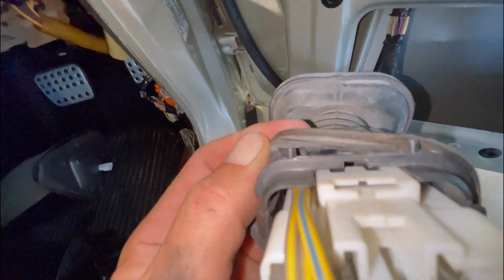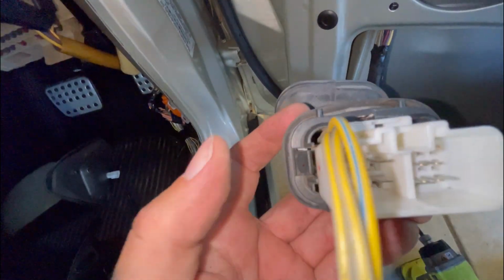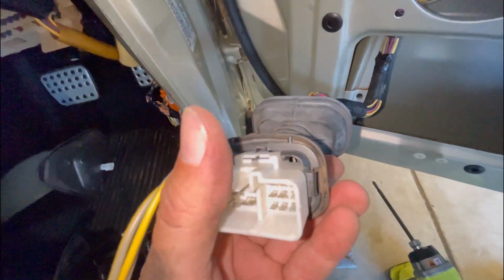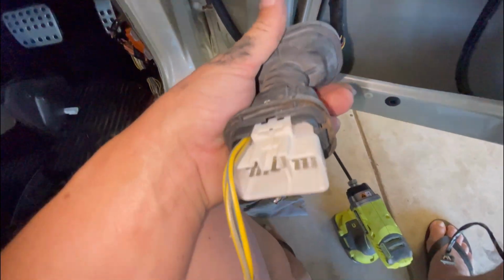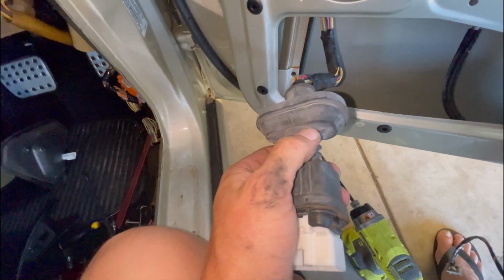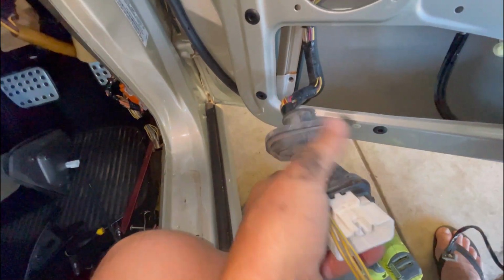So you slide it back off there, and then if you look where these wires come through on this side, there's three fairly decent gauge cables there. You've got the same space on this side in that little hole. So that's how you can run some cable through. So you obviously need to fish the cable through there, through this conduited grommet, and then through the other side, and then you've got it running into the car.